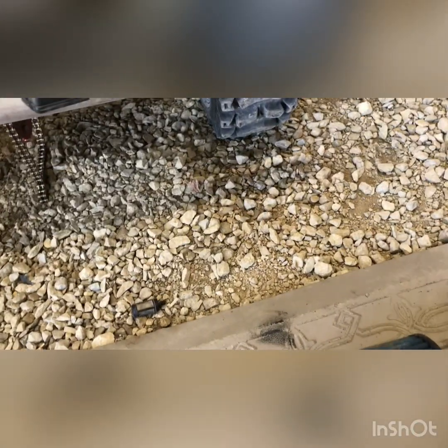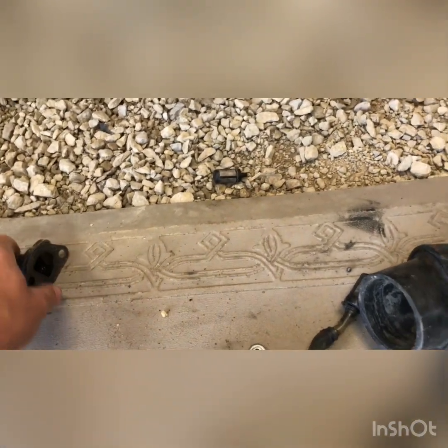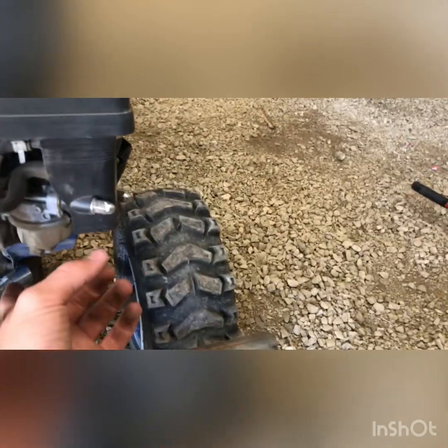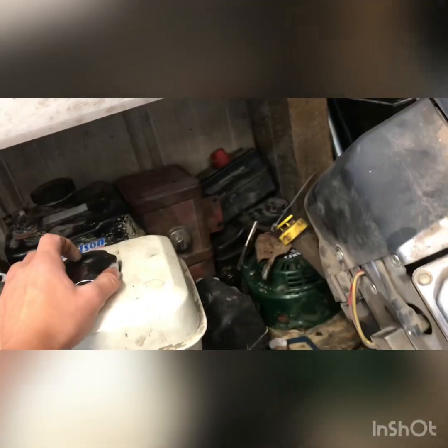Yeah, so don't put your overhead valve cover vent on the air filter. Make sure it's dangling down below it or something. It comes with a gasket for the muffler, and it comes with the emulsion tube. It's in my old carb on this motor, which is over here somewhere, but I'll just do a carb swap on it or something.